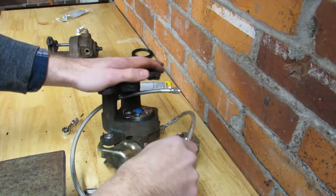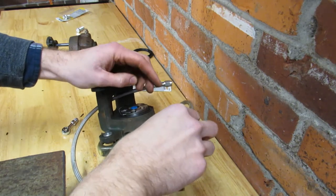Let's go downstairs and take a look at the Wilwood calipers replacing these — with the power of movie magic. Earlier I mentioned my secret recipe for the best brake system on a terrible budget: mid-size GM calipers on the rear, full-size GM metric calipers on the front, a one-inch master cylinder bore, and — here's where things get interesting — if you want more of a manual brake feeling, go with a seven-inch booster. If you want a more modern highly-boosted feel, go with a dual diaphragm nine-inch. This setup has never let me down over the years.